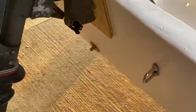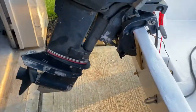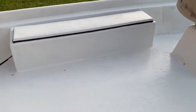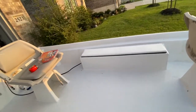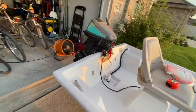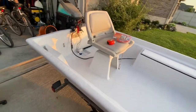I forgot what this plug is called — it's the tight lift. I forget to put it in, it'll still seal. It's got a little ball on it. The motor is just kind of tacked up there at the moment. I've got some figuring out to do wiring-wise. I want to be able to — those of you who follow anything else I do know about my kayak battery for my trolling motor system. I want to be able to just open the lid, drop that in, connect it like I do the other. There's not a whole lot of amp draw on this motor, so I think I'm going to do a trolling motor quick connect and have the battery inside and just plug right in, tap right into the battery. Quick disconnect everything.